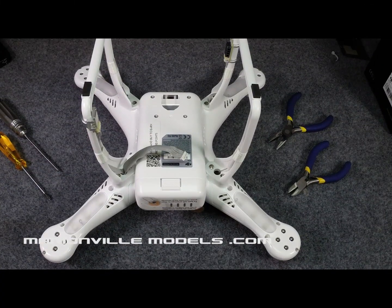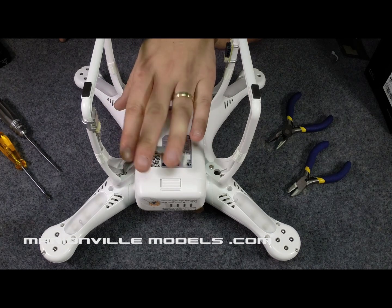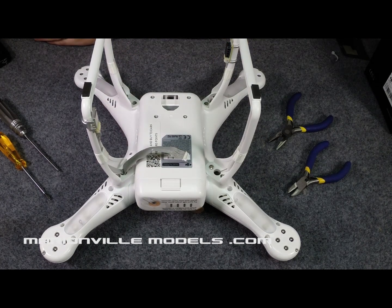That's the body all back together. The next step is to fit the gimbal, but as I've already covered that in my other video on fitting the new H3 3D gimbal, there's no point going over it again — just switch over to that video, follow it about halfway through, and then pick up from fitting the other method of the interference board. Both systems work absolutely fine. There's a bit more work doing it this way, bringing the cable out on the other side, but if you want it screwed in with cables not pulled quite as tight, that is the method DJI now recommend. Strangely enough, they don't include the instructions with the gimbal, but you can download a PDF from their website — though if you've just watched this video, you won't need to.